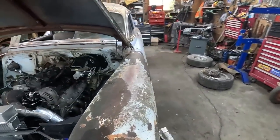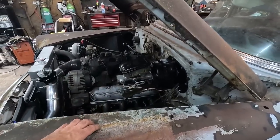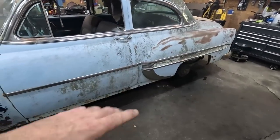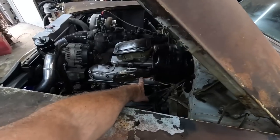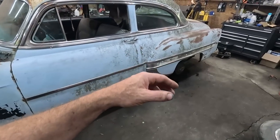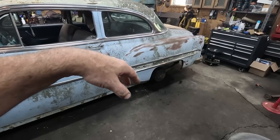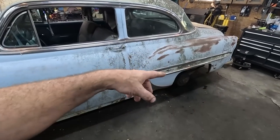Well now, that was a lot of suck. I had Ryder on pumping duty. We couldn't get any fluid out the back, so I thought the hose was collapsed, but it ended up being the prop valve just not wanting to bleed properly. We just kept cracking it, then it actually started bleeding. The front we had no problem bleeding. Kind of did it backwards, because I thought the line was bad. Took the line apart, wouldn't take any fluid. Once that worked, we were getting fluid back there, then we were able to bleed it.